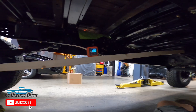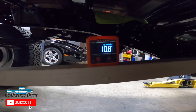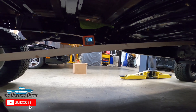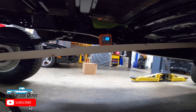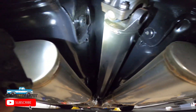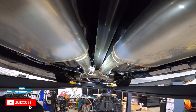I cut a piece of wood to help me get very close to determining what my drive shaft angle is going to be. What Spicer recommends is a slope no greater than 7 degrees. We have a slope of 10.8, so immediately you would think you have an issue, but that is actually not the case. Spicer is very conservative with their numbers. If you go on Tom Woods' website, he makes it very clear that up to 15 degrees with a single piece non-double cardan drive shaft is more than acceptable, especially given that you're running bigger yokes. We're going to be doing 1410s with this particular truck. That brings us to the next two things: offset and critical speed of the drive shaft. Offset means the drive shaft is farther to one side than the other compared to the front of the transmission.